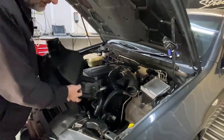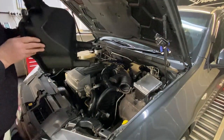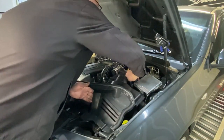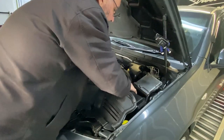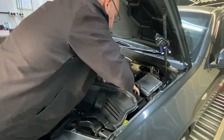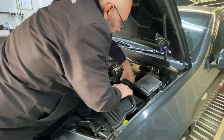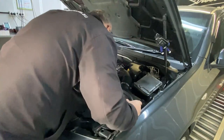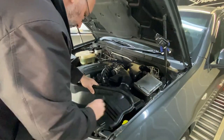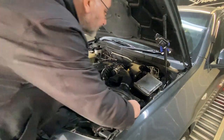Now these two lugs under here will be accommodated by the two standard holes on the chassis. And you might have to just maneuver your intake ducting while you're putting your box in. Just a little bit of fiddling around there. The little hole on the Street Fighter airbox accommodates your aircon fitting there, so that should come through nicely.